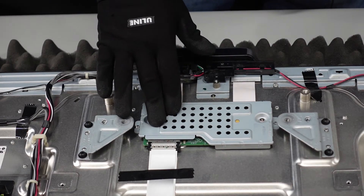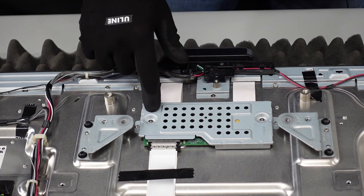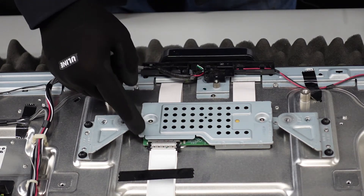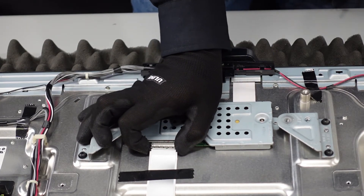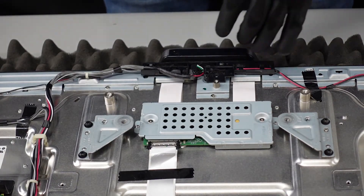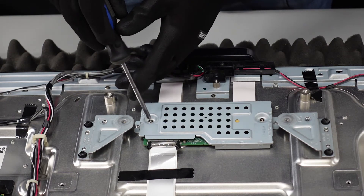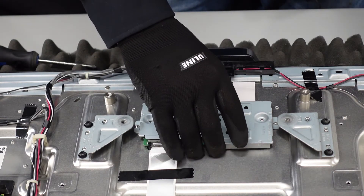Next, we are going to be removing the t-con board. You will see that it is covered with a metal housing piece, and there are a couple of clips. There are two ribbon cable connections actually underneath this housing. We're going to get that up and away first, but let's get this LVDS cable removed — there are two buttons on either side that you want to depress. Now we're going to be using a finer tip screwdriver for these two screws here, just so we don't damage or strip them out while removing them. After those two screws are out, this piece should just lift up and away.